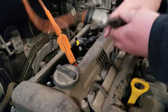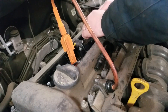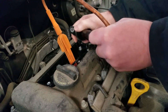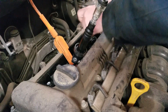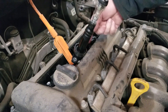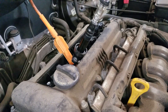We could use a lab scope to check the signal, but since we have good coils sitting right here we can do this same test with a known-good coil. Make sure that's all the way down in there, and for comparison we'll plug this into number four. So what we've done is swapped cylinder four's coil into cylinder two's position, and we're going to verify that the computer can actually fire a coil. If it can, we should see the test light blinking with this known-good coil.